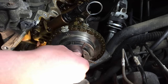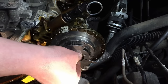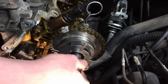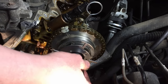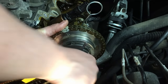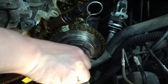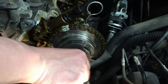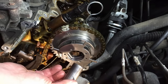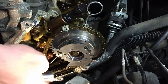Keep tightening the phaser bolt — you can see it straightening out and helping everything line up. It's going to be tight, but you can look behind and see the pin going into the groove. And boom — it hits a dead stop by hand. No chance of shearing off that nub if you line it up and do it by hand, because you'll feel it seating.